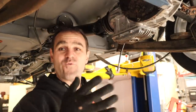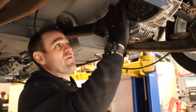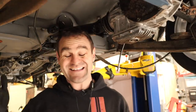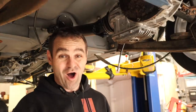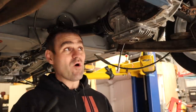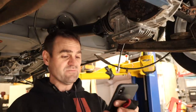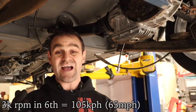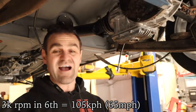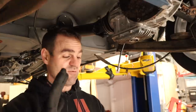The diff is a 1041, which is a 4.1-to-1 ratio rear end, coupled with the BRZ gearbox and the Ferrari engine which has a red line of 8,700 RPM — it's quite a high-revving flat-plane crank V8. Drivability-wise the ratios work out well: at 3,000 RPM in sixth gear on the highway, this should be doing 65 miles an hour (105 km/h) — quite nice, revving nicely. Red line in second gear is 66 miles an hour (106 km/h), so a nice usable gear range, which is what you want on a car like this.